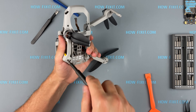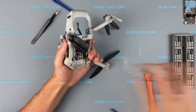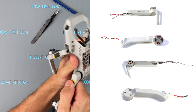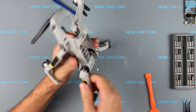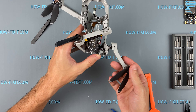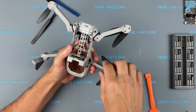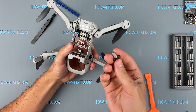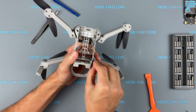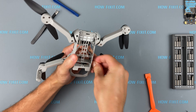How to replace an arm with motor I will make a separate video, but in any case I'll leave a link to the replacement parts in the description. Now moving on to reassembling the DJI Mavic Mini. When installing the latch, be sure it does not interfere with the cable inside the drone's arm.